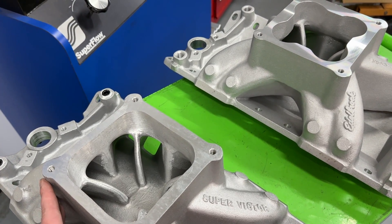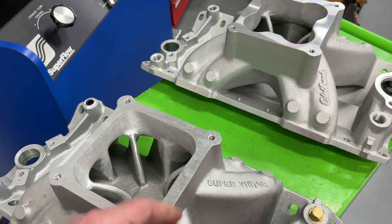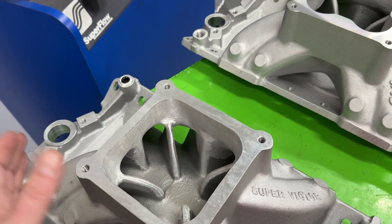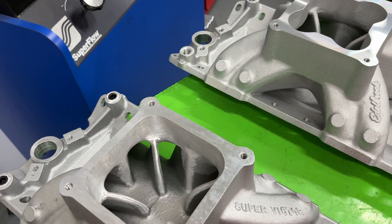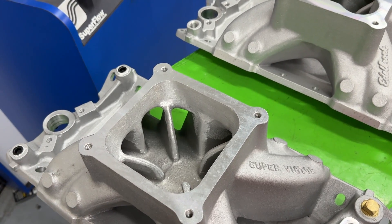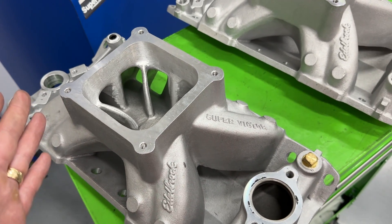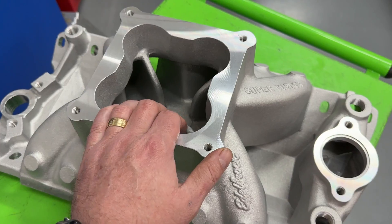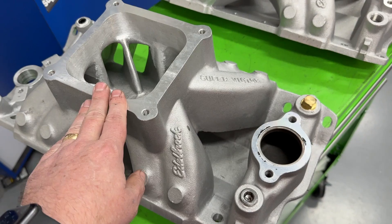I thought this Dominator one would show a bigger difference. For the record, on the 4150 with the AFR, once the cloverleaf was removed it actually lost power. But the one I usually take the cloverleaf off of is this Dominator-style manifold. And I have to admit, like I said, the only reason I started even removing this is because it was kind of monkey see, monkey do — someone else is doing it, it seems like it should make more power, even though I'd never done a direct dyno comparison.